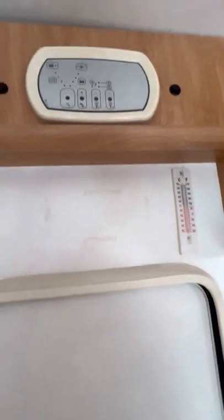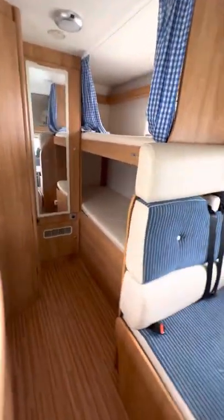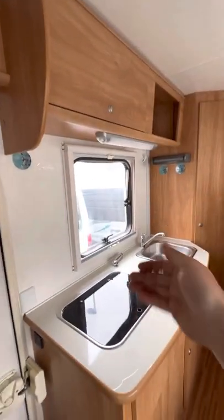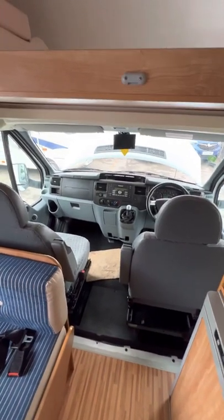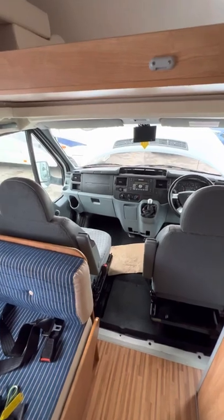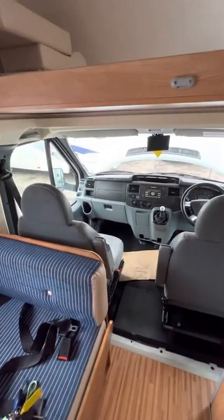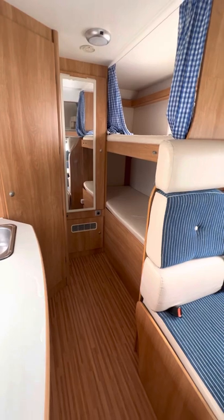It's a reasonably short video because it's so straightforward. Before driving off, make sure you switch your fridge over to 12V, turn your gas off outside, make sure all your skylights are properly secured down, all your windows are shut and everything is closed. Motorhomes can be noisy and rattly when driving, so non-slip mats — especially in the grill — are quite useful. If there's anything I've missed or you want going over again, just let us know. I look forward to seeing you soon to collect your van — thanks very much.